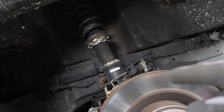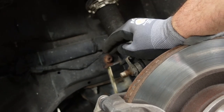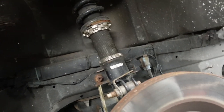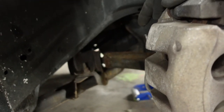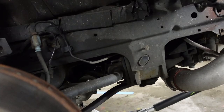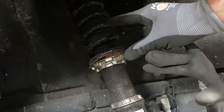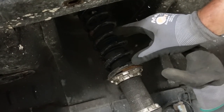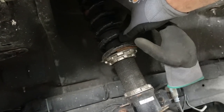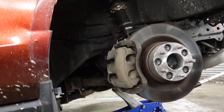Pretty much the entire hub assembly has to come out and the coilover has to come out too. They're a little more rusty than I thought — hopefully the end links don't snap. Springs are a little messed up; maybe someday I'll get some sponsorship through a suspension company. You're going to want to take the lower control arm off, and the sway bar might possibly have to come out — we'll cross that bridge when we get there.